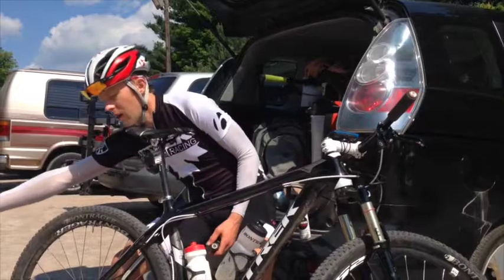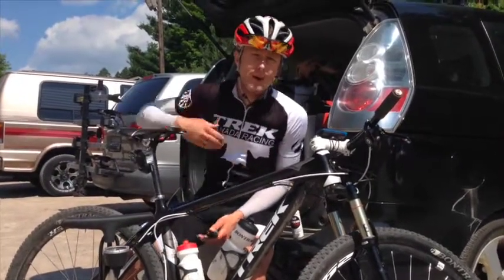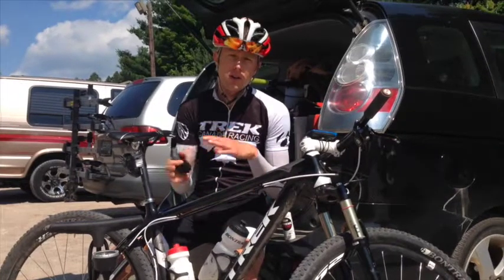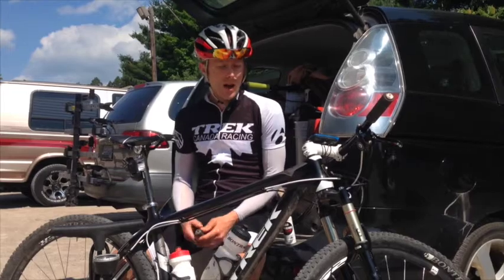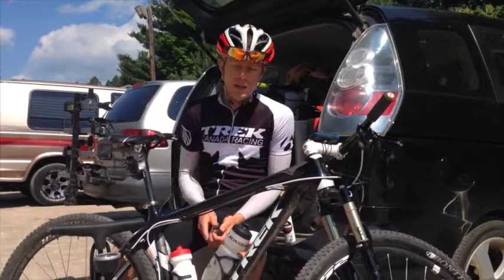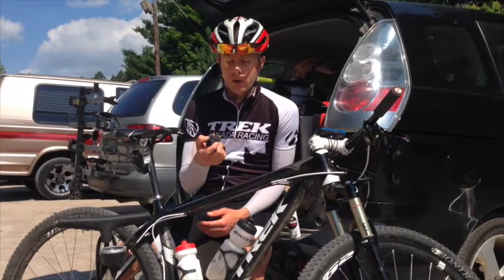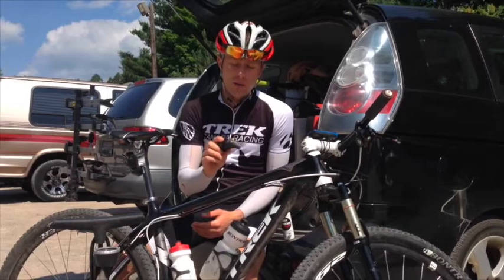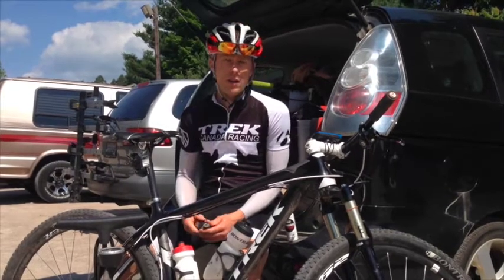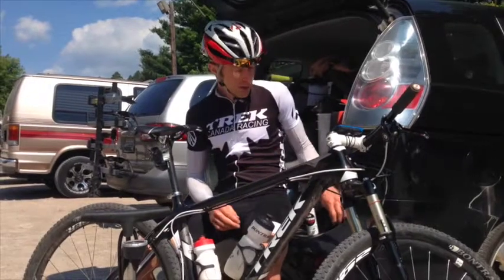with their pump. Before pretty much every ride, especially with the tubeless stuff, there's going to be a little seeping overnight, and depending on the terrain, we're going to want to keep track of what we're using on different terrain, for racing or whatever, and keep track of that like you would any metric. A nice digital gauge is another thing you can put on your Christmas wish list, because between different pumps there's always going to be variety, whereas the digital gauge is going to really tell you, 23 is 23. So that's our tire pressure.